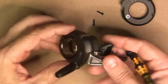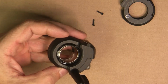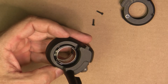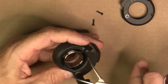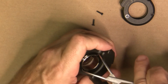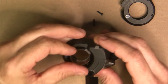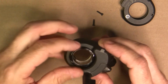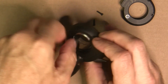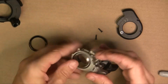The other thing we need to do is flip it over. There's a ring right here that has to come off to be able to pull the plastic cover off. I took a pair of forceps and stuck them into those slots, and with some significant pressure backwards it will turn and just backs off like that. That pops off of there, removing the plastic cover.